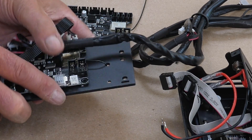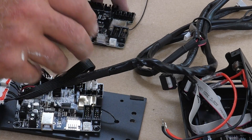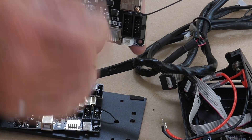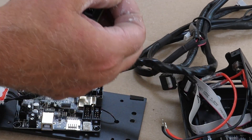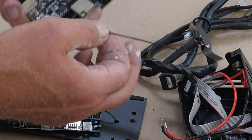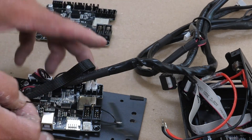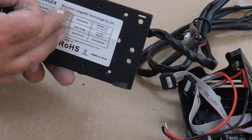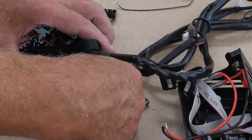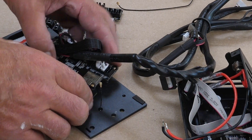For your Wi-Fi, you'll see you have this little wire right here, and I'll show you on the new motherboard. This little brass-looking, gold-looking connector — it just plugs on, so you don't have to take the label and everything apart on the back side to get to this lead. You can just unplug it by carefully tilting it up a little bit and it'll come right off.